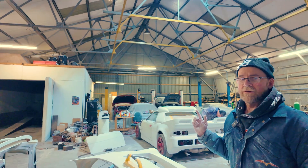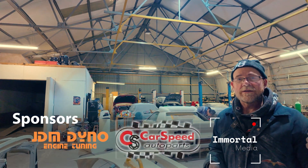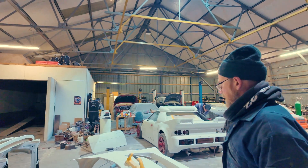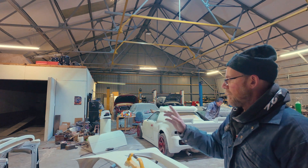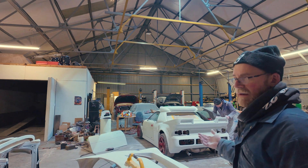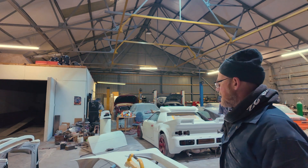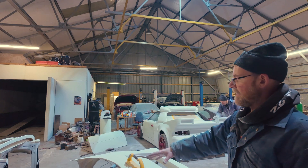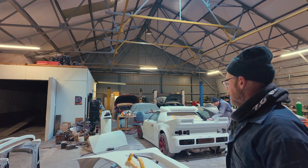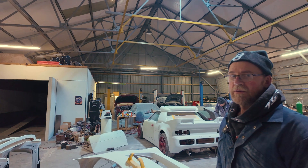That's me done rubbing for the day. Jonathan's on with the clams still. Megan's coming to pick me up because I've had to take the wheels off the Jag — they're now not round anymore, so I need to take the wheels to get straightened. It's Monday now, I'm back on Thursday. Bonnet's rubbed, needs a tiny bit of filler. Bumper's rubbed, doesn't need anything — that's ready to go. Clam's getting through there, we think we're through all the filler bits that needed doing now, it's just a little bit of tweaking, getting the primer 180'd. So that's going to be a full reprime on the clam — everything's going to need a full reprime. Not too sure about the side skirts yet, but back on Thursday, hopefully I'll have everything ready to prime on Thursday.